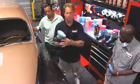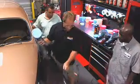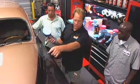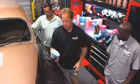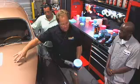Okay, just like that. Cord over shoulder. I don't see anybody rubbing the cord up against David's very beautiful car or Pete's very beautiful AC Cobra. So cord over shoulder. And here's the lesson you need to pay attention to. Don't ever turn this on till that pad is in contact with the paint.